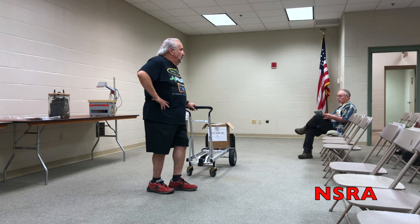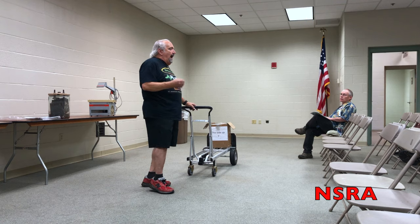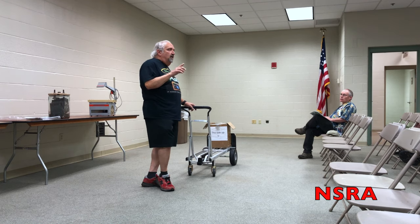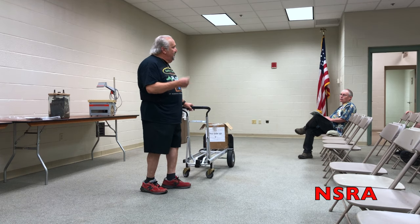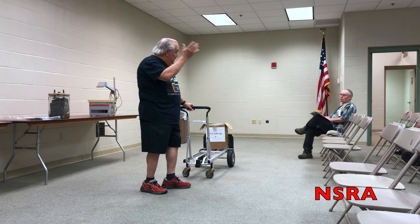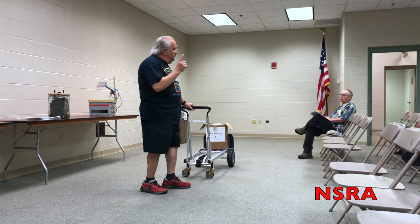One of the things I do when I go into a store is I take a little voltmeter with me, or we have a little tester built in our things. I test the battery for voltage because I don't know when they put those stickers on when you buy them. They could put them on whenever they feel like, and I don't really trust them. If they're like me and you're a retailer, you put the older inventory in front. Well, I don't want to buy an old battery. So I look for the highest voltage.